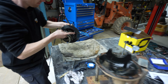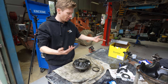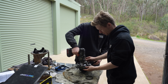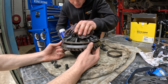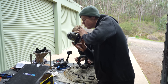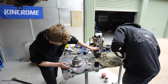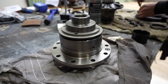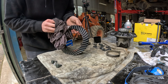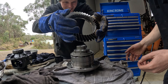There comes the centre. Now we've got it out - this is our old ring gear, which you reuse when you put in the pro locker. We'll smash all these bolts out, take off the old gear, and throw it onto our new locker. There is our ring gear. We've got our new centre out of its box - it looks a little different to the old one. We still need to press on our carrier bearings, but first Liam cleaned up the ring gear. Hopefully it fits straight away, otherwise we might need to throw it in the oven just to expand it a bit.